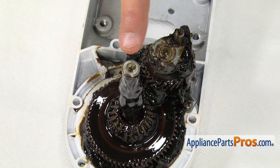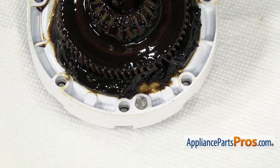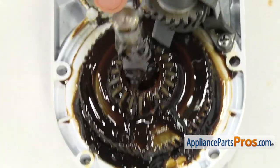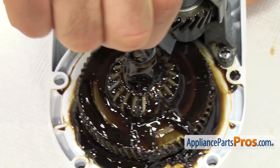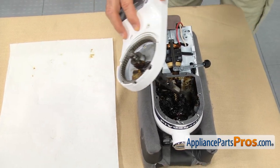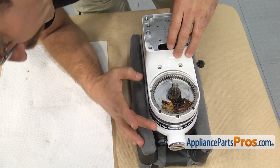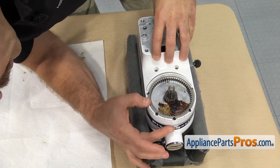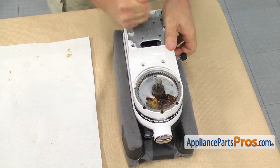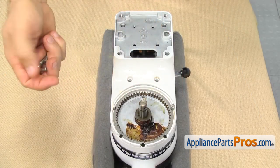In order to put the mixer back together, we have to make sure we line up the center shaft with its seating point down in the housing of the mixer, and then there are two mounting pins — one here and one here — that we have to line up. When you're picking up the assembly, if the shaft has settled, make sure that it's engaged and moves the gears when it turns. Once you're sure it's in the right spot, we can put the two halves together. You may have to move the case seal around a little bit if the pin hole didn't line up perfectly. Once you have it lined up, it should go together pretty easy. Then we can put all the screws in, go around and put them all in first, and then use the flathead screwdriver to tighten them down.